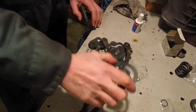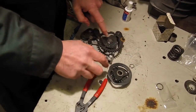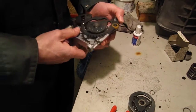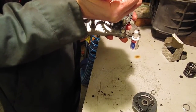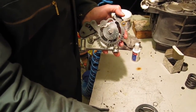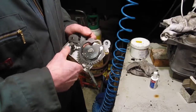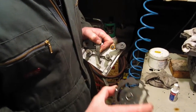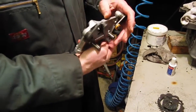We can pull off that cam plate. We've got three cam rings because we've got three selector forks — each selector fork slots into those particular cam rings when assembling. To get the next one out, we've got to take this circlip off. Then we can pull away from the cam plate and slip that cam plate up. You'll notice it sprung out as we did it — that's okay.